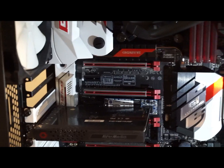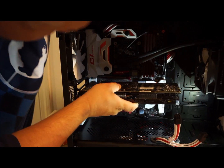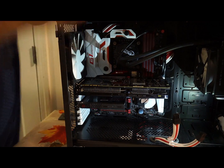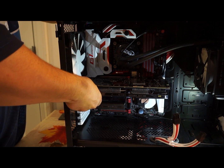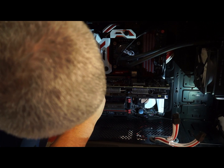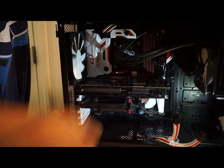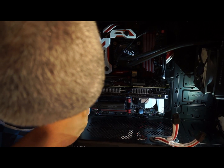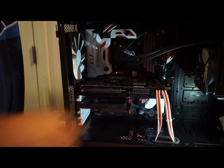Now I'm going to zoom out a little for you guys. As you can see, the capture card is back in. Next is my graphics card, which goes in like that — make sure it clips in. It will take two screws on mine — I apologize if you guys can't see the screws going in, it is a tight fit right there. One more screw up here, and then connect your two six-pin connectors back up to your graphics card. And that's how you put your M.2 in.